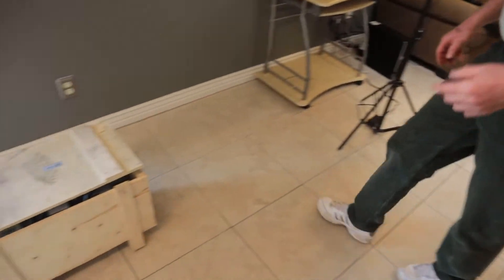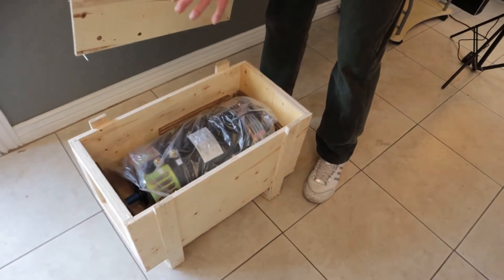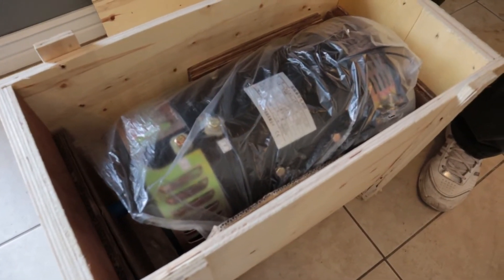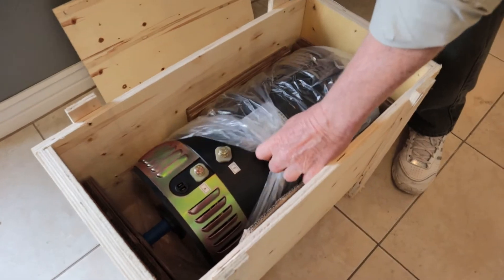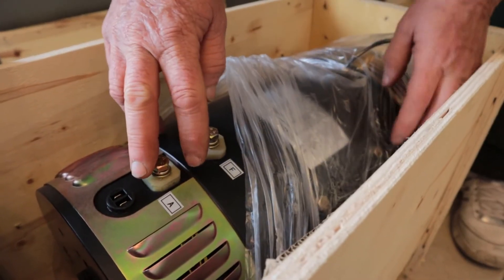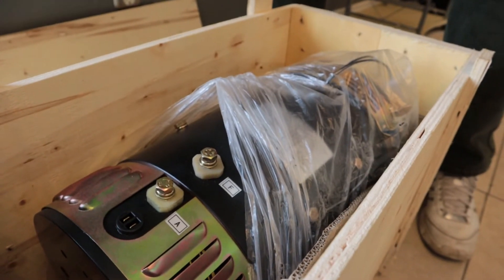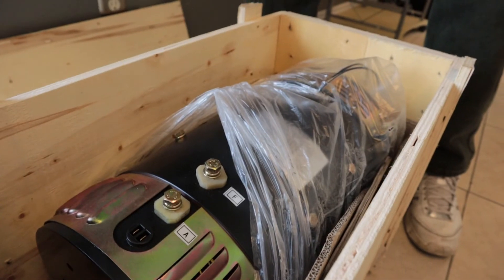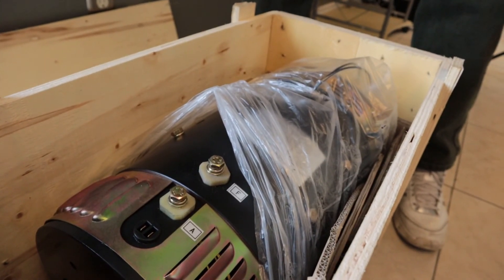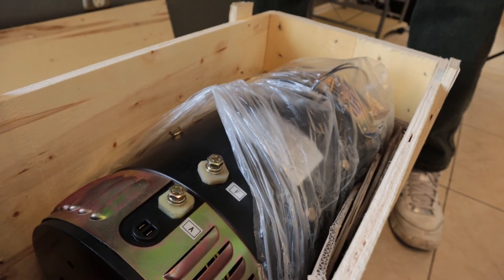This motor is a very different motor than that one. This is a technology that's been around for a long time — a hundred years. This is a series-wound motor. This motor does not have magnets in it; it is designed to have electricity feed both the stator and the rotor. This motor can put out about 90 horsepower — four times the horsepower of that one. This is a motor that can power a car of 4,000 to 5,000 pounds, in other words an average SUV or a pickup truck.